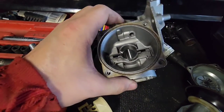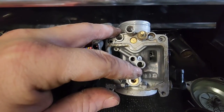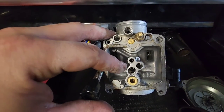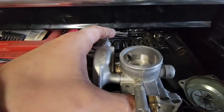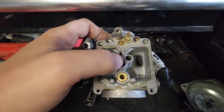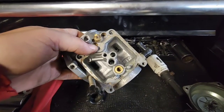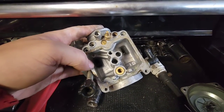Real quick - I misspoke. That jet is not your pilot jet. There's a jet down in that hole that is your pilot jet. With that out, it's real important to spray carb cleaner straight down through there. There's a little tiny hole and you can see it come out into the body of the carburetor. By spraying carb cleaner down this hole you'll see it come out through other holes. I like to plug each hole individually and force fluid through another channel.